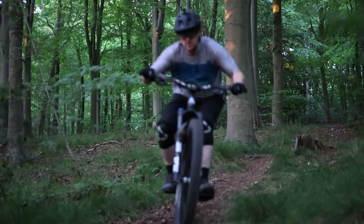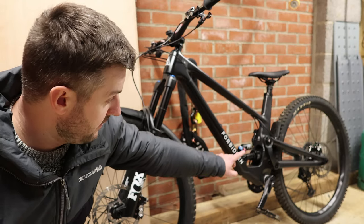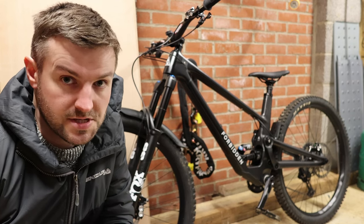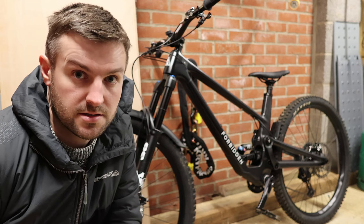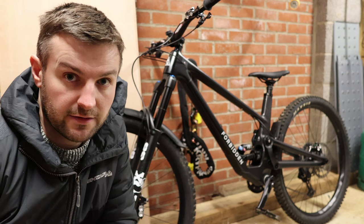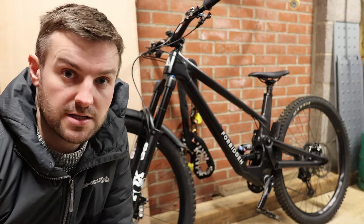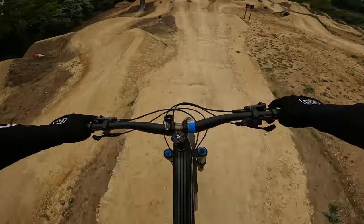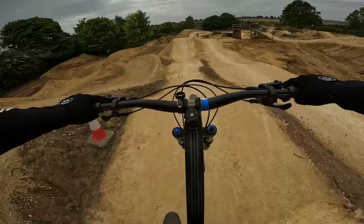The reality is that this bike is a little bit too much bike, and I think it's made worse by the fact that it has that rear axle path for the swing arm. The bike grows in length as the rear wheel goes through its swing curve — it travels back, meaning the bike lengthens out and becomes more stable, but it is less playful. It's harder to pop off jumps and definitely harder to bunny hop and manual if that's what you're into.